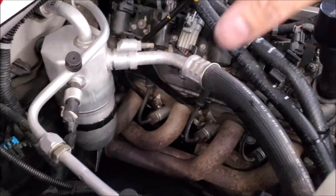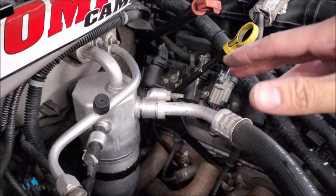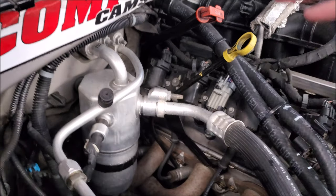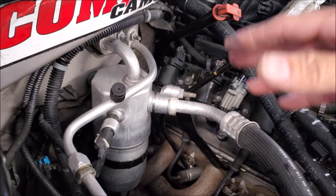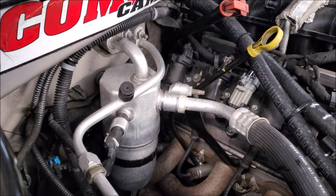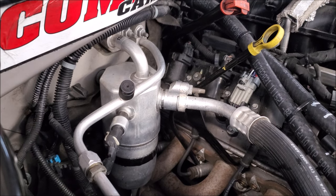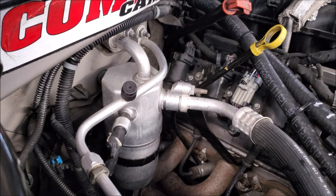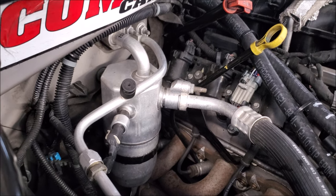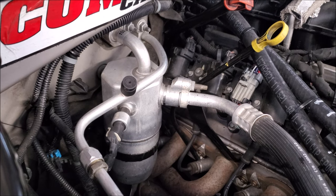For the air conditioning system, when I put the heater core in I went straight to the air conditioning shop, had them reattach, inspect everything, put on any new fittings they needed to, and pressurize and test the system — that's why it works so well. I highly recommend you get a pro to do it. Don't use those do-it-yourself kits because they have propane in them — they're highly flammable. The refrigerant used in the shop is very different and much better for the system.